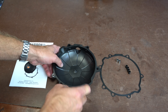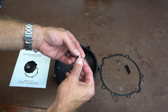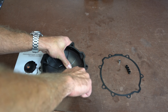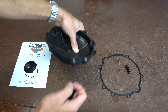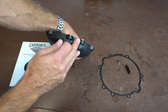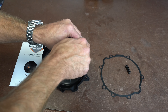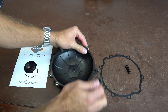It's very important to prep our clutch cover by putting these sleeves into it. They give you these different little sleeves and the sleeve insertion tool. Some of these are hard to push in — you have to push pretty hard to get them down in. By design, this tool leaves about an eighth of an inch or so up on that. You're not supposed to push them down flush.